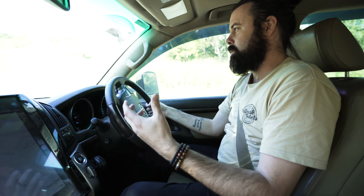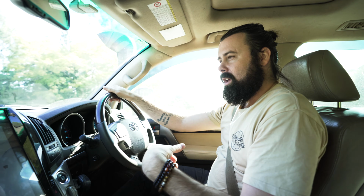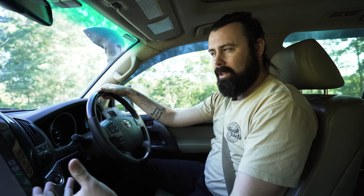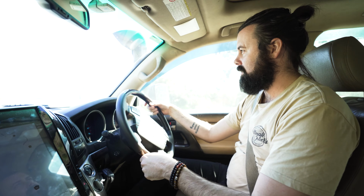So the advantage right now, especially if you're towing, is by locking the torque converter up, I'm getting maximum torque to my rear wheels, and I am creating no heat, no slippage in the gearbox. It just makes the car's job a lot easier to cruise up the hill, especially if I'm towing a lot of weight, as I said.